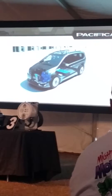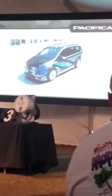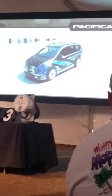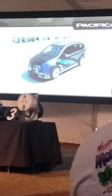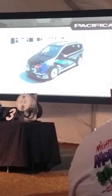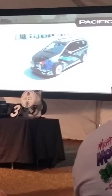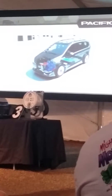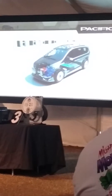At some point, this system is going to say that either speed or torque availability is just simply not there to support it as a dedicated electric system. We're going to turn on the gas engine. So I'm going to turn the engine on here for you. Now you can see we've got the gas engine running — the 3.6 is running — but what I want you to take a close look at in this video is: the gas engine is running and operating, but what's happening to the current path? Has it changed since the last screen?